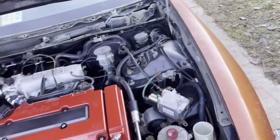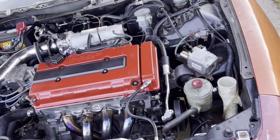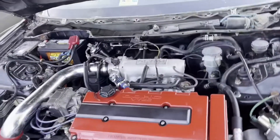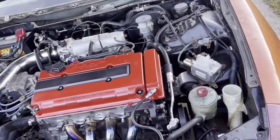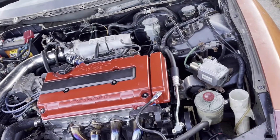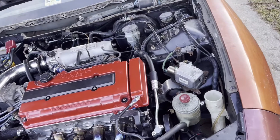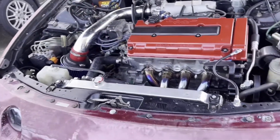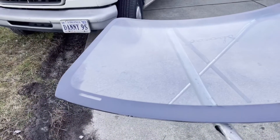It actually ran really good this morning. After it warmed up, there was a little high idle, but as soon as the IACV opened up and the coolant started getting hot it ran good - idled good, took off good. I didn't even have to push the gas pedal, I just let off the clutch a little bit and it started going. Good shifting, everything. Drove it down the road and backed it up, and as soon as I got in the driveway he showed up.